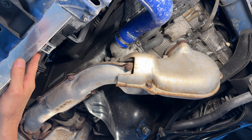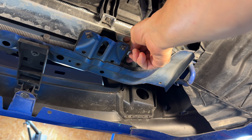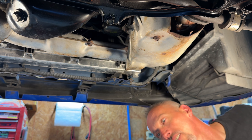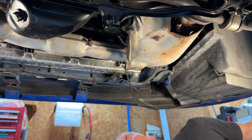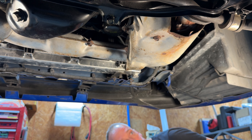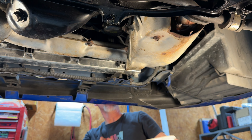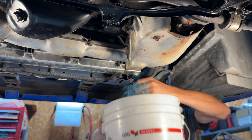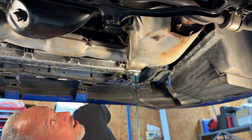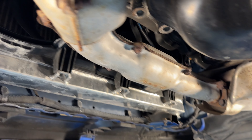This is one of those fancy Mishimoto radiators, so it looks like we've got a drain right here. You'll have a drain cock on your plastic radiator somewhere in the same area. It wasn't even tight — should be more than finger tight, but I guess if it wasn't leaking that's good enough. It's got a fast drain on it, which is pretty cool. Your petcock valve on a standard OE Subaru radiator isn't going to go that fast. Plug's back in.